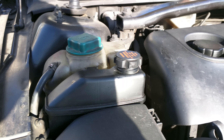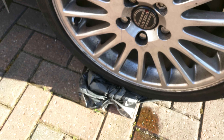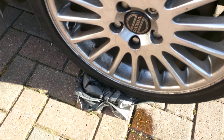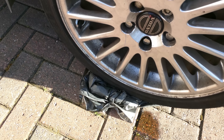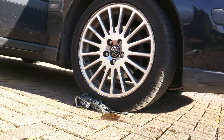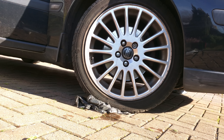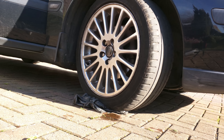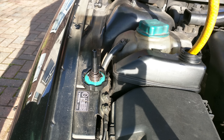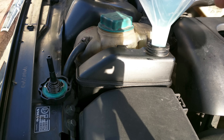What I'm going to do now is flush it through the car. I don't even have to put the car on jack stands — I've just placed folded bin liners under both front wheels. What that does is stop the tyres getting scrubbed because I'm going to be doing lots of lock-to-lock changes, and it also reduces stress on the power steering pump. I'll just start the car and repeat the emptying of the power steering reservoir, measure out the same quantity, and replace with fresh.